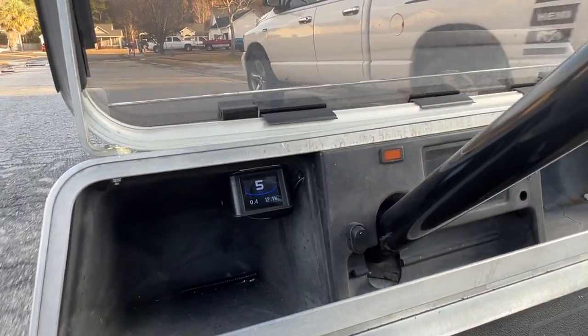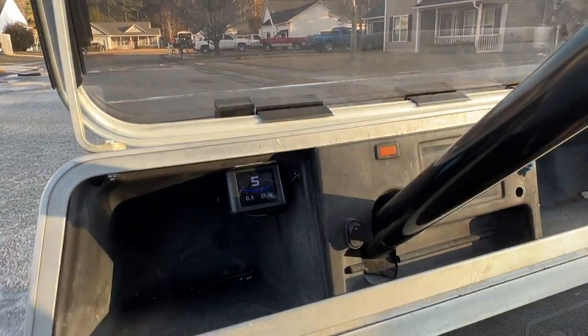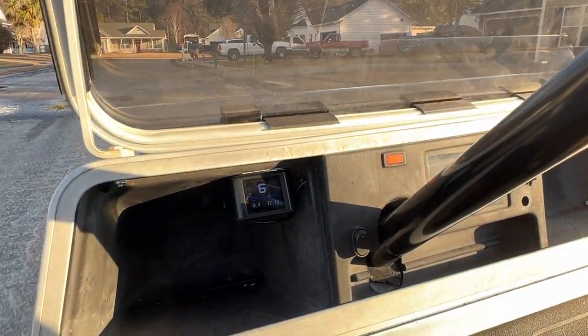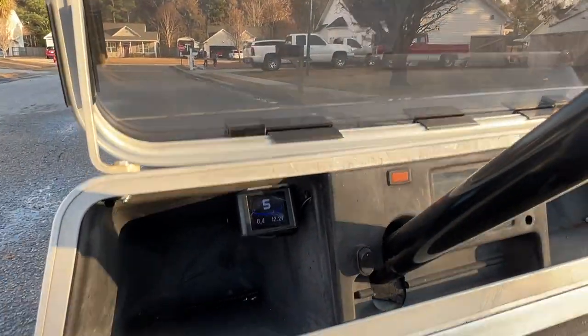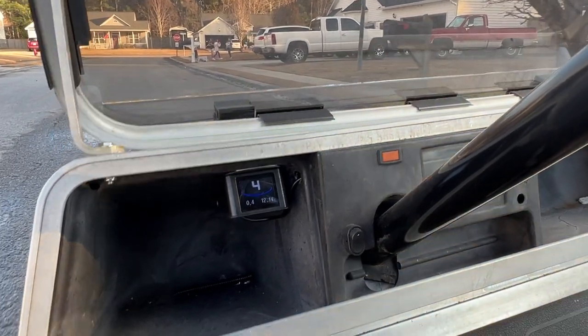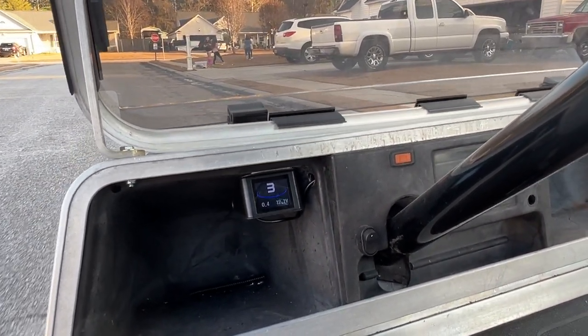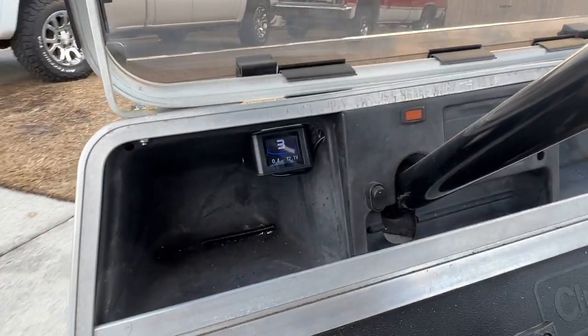I'm happy so far. We went from 10 or 11 miles per hour, we did the lithium batteries, went up to like 12 or 13. Now we did the Alltrax controller. We're at 15 miles per hour right now. I can't wait to get to the next video. We're going to do the Plum Quick motor in here and see what kind of speeds we can get. We might adjust the controller a little bit more, see if we can get some more out of it.